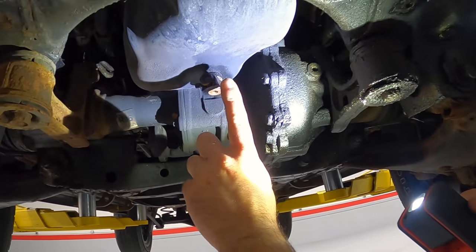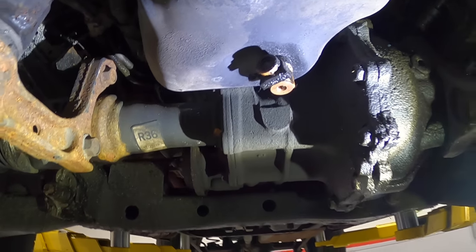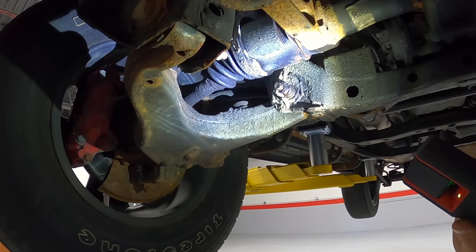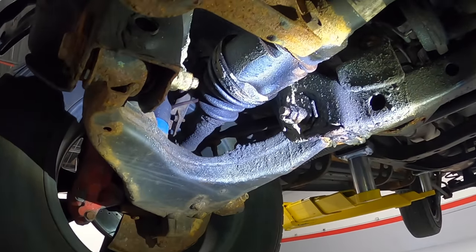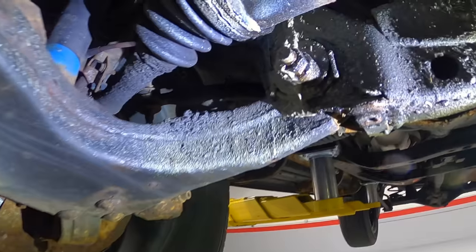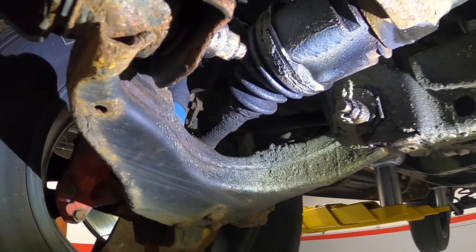The owner has one of those quick-change oil filter adapters — I don't like these because you're putting the life of your engine on a little plastic clip. Not a great idea, but it's their car. Moving on from that, we have a leak right here — this is an inner CV boot on the passenger side. It's leaking and throwing grease everywhere. These are not super common on these, but as they get older you'll see them. The fourth generation 4Runner is a lot more notorious for this than this one, but this one is leaking and we're going to mention it to the customer.